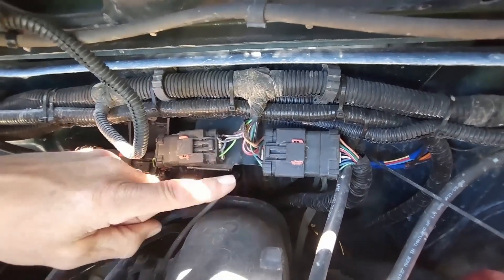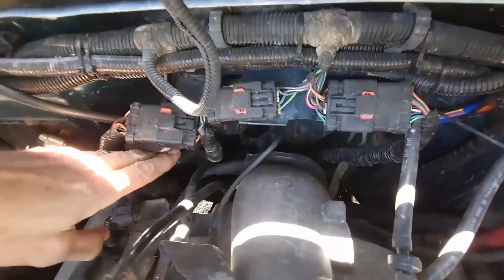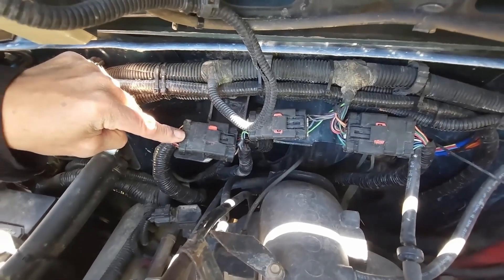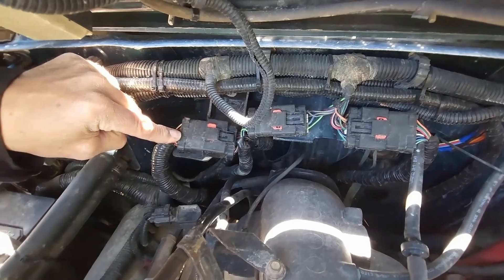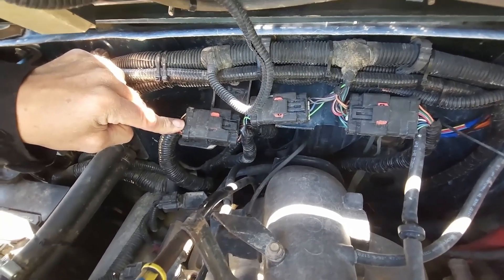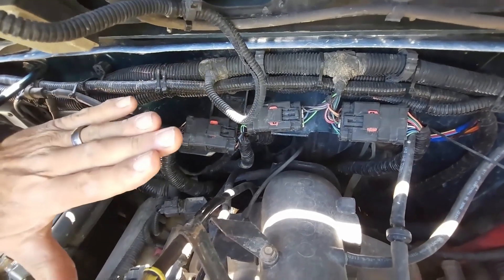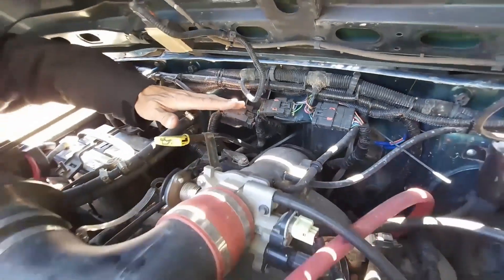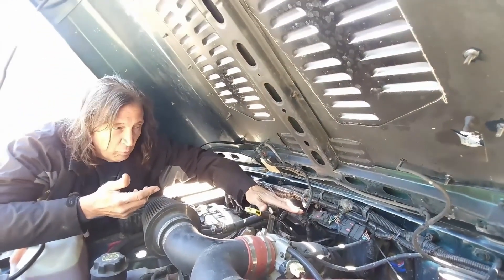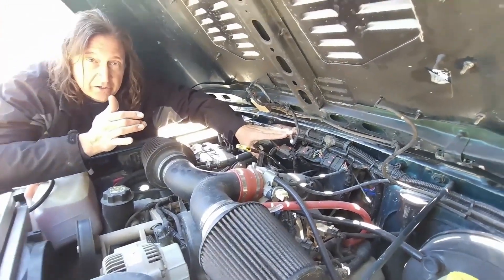You're going to have to dismantle your old harness and harvest these two plugs as they trail back down the transmission. This plug will not exist — this is something that I harvested off of a wrecked Grand Cherokee and fused it in so that this entire engine can be completely removed, transmission and all, unplugged, and the wiring harness comes out independent with no intertwining. You can take it off in one unit and get it out, leaving the fuel pump and all of that hooked up.